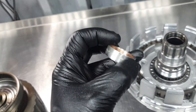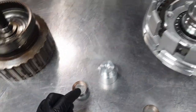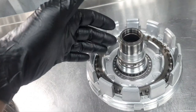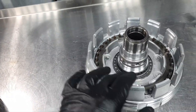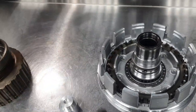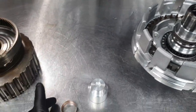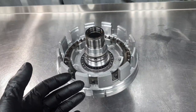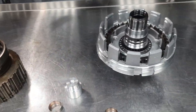Like I said, there is an order. Yes, like this, it goes inside. Cooling it down, warming a little bit up, not more than 90 degrees, with a heater gun, with an air gun, not more than 90 degrees, because this has also been press fit inside. You don't want to make any mistake here, don't make any damage. This one, cooling it down the classic way, and then press fit it. A little bit of oil here, and everybody happy.